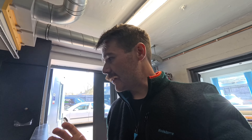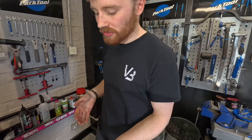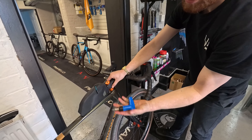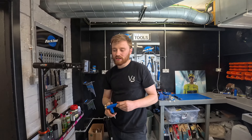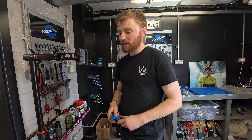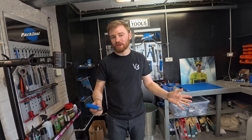I have something to add, especially for bikepacking: Silca make an amazing mini torque wrench system — it's very expensive but it's about the size of a wallet, and that's what I take on bikepacking trips. The torque wrench used most in the bike shop is a clicker — it's already set to a fixed value, but you can change it to 6 or 4 or whatever, and when it clicks it's at the right setting. I used to travel a lot for racing and would take one of these — you can do your seat post and stem, which is chances are all you need when you travel. But if you can only have one, go for the slightly bigger one with all the little bits so you can do everything.